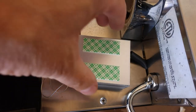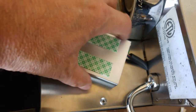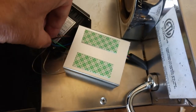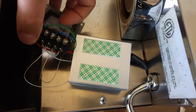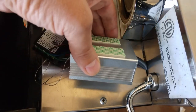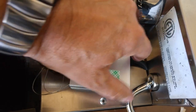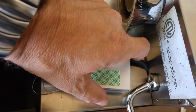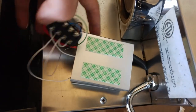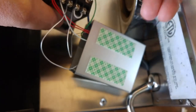To connect the wires to the controller, feed them through this gap here using plastic or silicone tubing, which protects the wire from being cut by the sharp edge of the stainless steel front or top of the machine. Because you have 110 volts on the brown and black wires, it's not good to get cut by the stainless steel. Attach the green wire to the screw at the corner, keep it close to the tubing, then pull the wires maximum out through the box so it's easier to connect them to the controller.